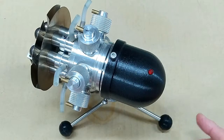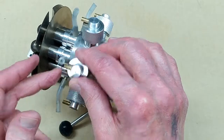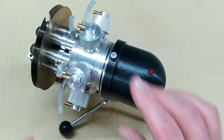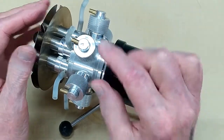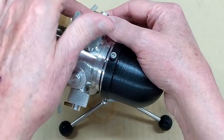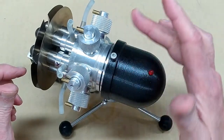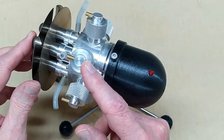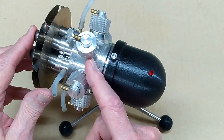The next thing I've found: I put my finger on that — I don't know if you can hear that on the camera — pop. That piston is traveling downward and it will pull a vacuum on my finger and you can hear that. I went around, did all of this, and found that one cylinder wasn't pulling as much of a vacuum as all the others. So I took that apart and replaced the liner and the piston glass.